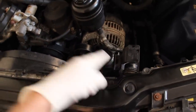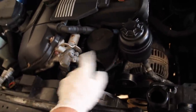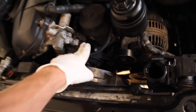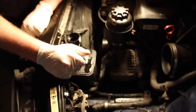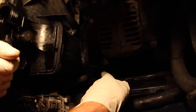The hose that plugs into the top of the expansion tank also goes over to the water pump/thermostat housing. Same deal — clip on top, pull the clip up, pull the hose off. That's an optional step; I just decided to get a little more room for when we're working on the fan. Removing this expansion tank's never been a fun thing. We disconnected the hose at the top, took the cap off, disconnected the hose at the bottom.